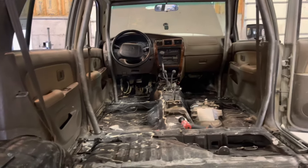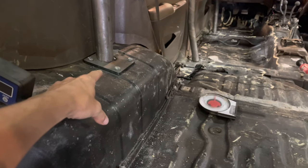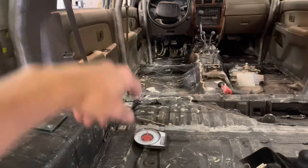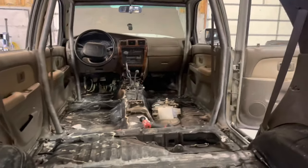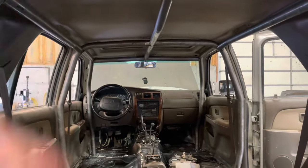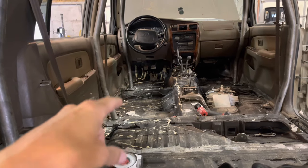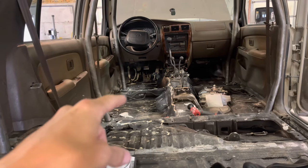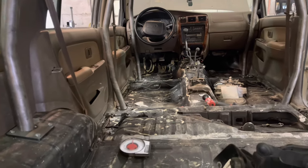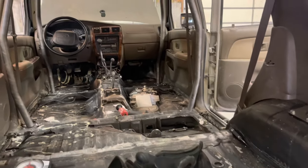Another suggestion was to drill two-inch holes in the body plates on every leg so you can drop the cage down to weld the top. I know I can't do that on the front body mounts because there are weird things underneath, but everywhere else I think you'd be fine. I'm just going to keep moving forward for now.